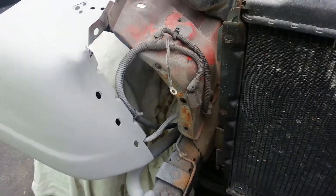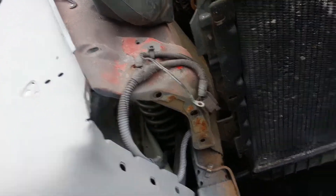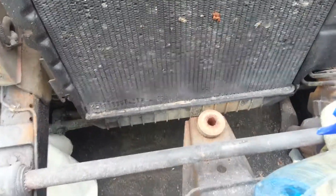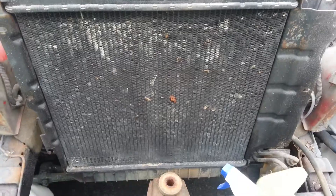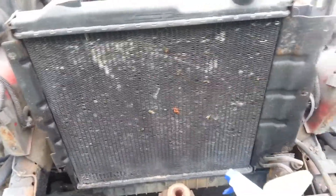There are three bolts from the fender, two on the inside, a center bolt which matches to the body mount, and there are six bolts on the rad. Loosen up the bottom two and remove the top two. They're really tricky to get at, but you're going to need some open-end wrenches and a lot of patience to get this one done.